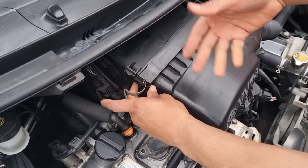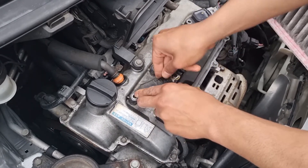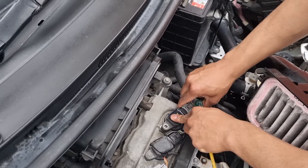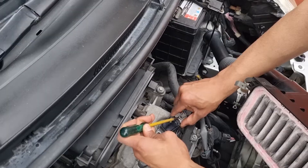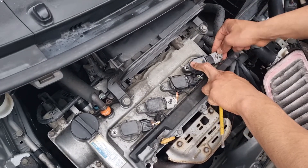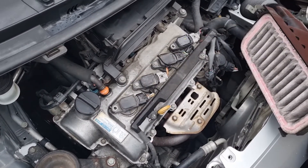Something I didn't mention earlier — you have to take the airbox off to get access to the coil. So now we'll disconnect number one. We can see no much difference at number four — this is going to come out, plug it back in. No much difference. Change number one — so that's a coil problem.